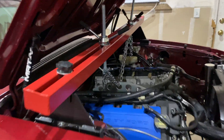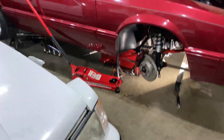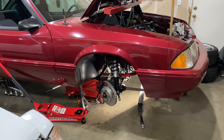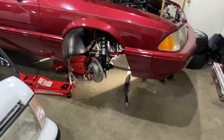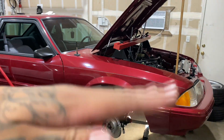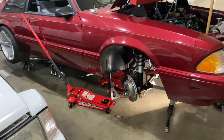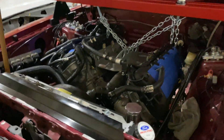I kind of tried to wiggle it out for like 5-10 minutes and said man, it's not gonna come out — so forget it, I'm gonna just take that header off. I got the motor hanging in the air right here — cradle's still in place but the motor mounts are undone. I was able to drop it about two inches, making it a lot easier to grab those header bolts. It is what it is — I'll pull that header off, pull the tranny out, put a new flywheel and clutch on, put the tranny back with ease using the transmission jack, and then just put the headers back on. I'm kind of bummed I didn't get it out without that.